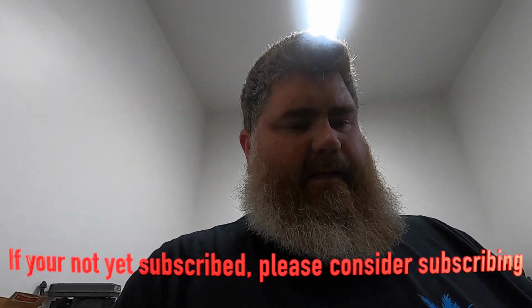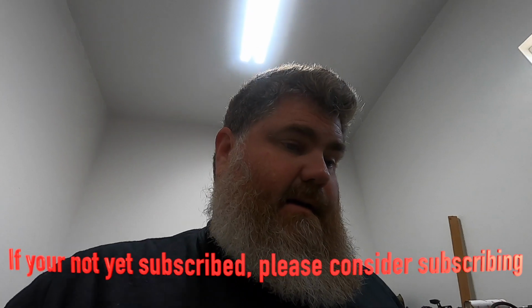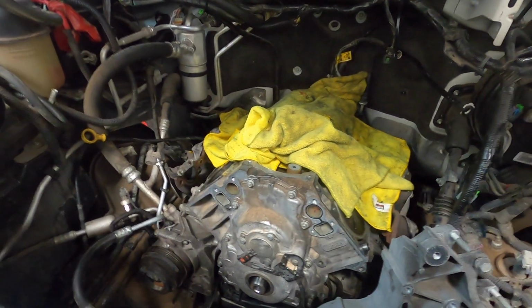All right, so like I was saying, it's a new day. Yesterday was definitely a challenging day, taking things apart, putting them back together. Talked about the cam phaser, all that stuff. So anyways, I got everything underneath, the oil pan back up. I got all the front diff and the steering rack and cross members and sway bar, all that back on. I got the front cover back on here.